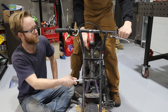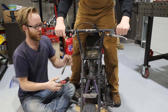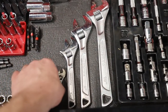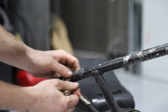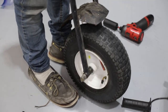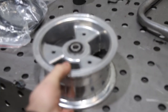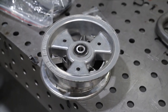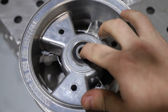The carb did pretty good at the end there, so now it's on to the front forks. Just gotta take these off. This wasn't exactly helping the vibration problem in the front. Because the bearing in this wheel was kind of shot, we dug through the parts bin again and found this kind of vintage-style two-piece Go Power Sports wheel - link will be in the description. We put some brand new bearings in it so there's not going to be any play in them.